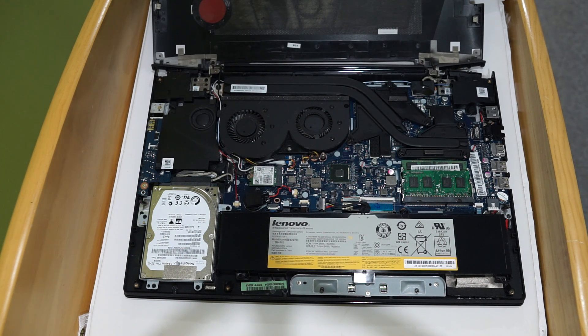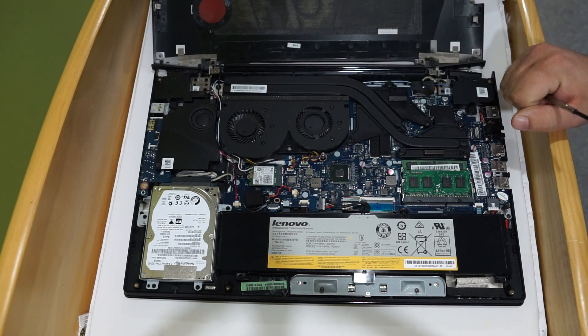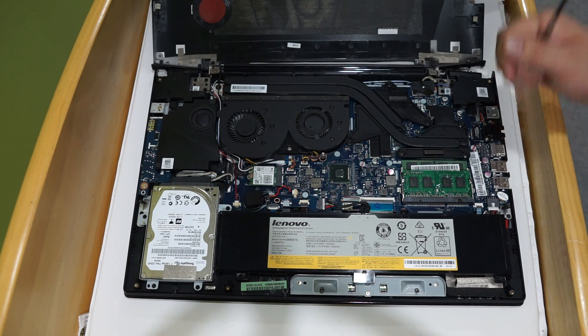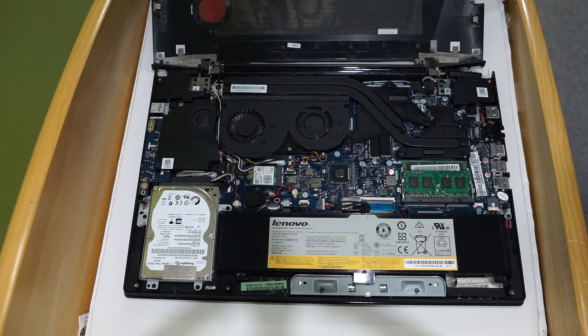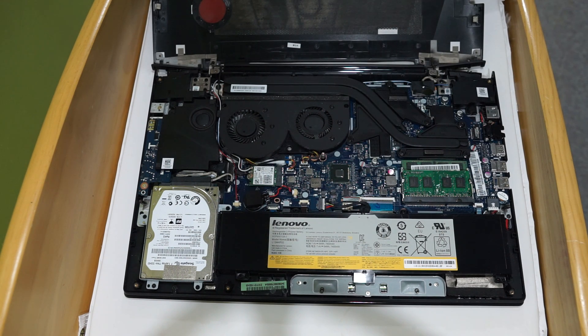So that's how you replace that. This laptop is pretty easy to service if you need to take off the heat sink — everything is kind of wide open. The only thing that would really look difficult would be the keyboard, because it has an island keyboard and it's not blatantly obvious how that comes off. But battery, RAM, hard drive, heat sink — all that stuff is easily accessible. If you have any questions, let me know, but that should cover it. Thanks for watching. Bye.